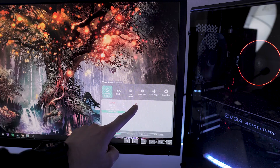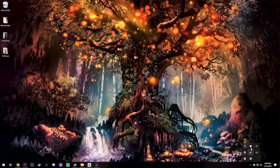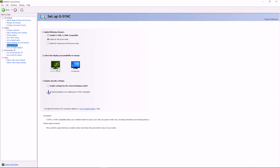You need to make sure that that is turned on. After you have this turned on, go to your NVIDIA Control Panel in Windows and open that up. You just need to go to the option that says Setup G-Sync. Click that, and you will see which monitor you have that is NVIDIA-enabled pop up right there — it looks like it has a GeForce logo on it. Then just select the Enable G-Sync, G-Sync Compatible option.